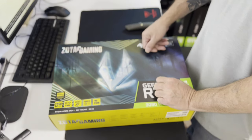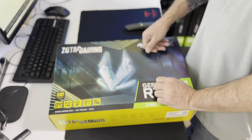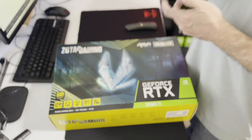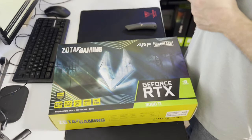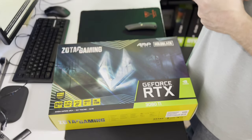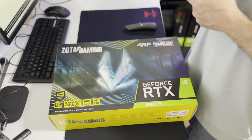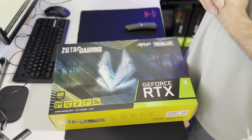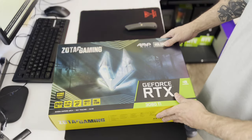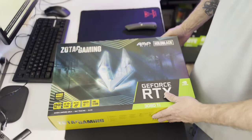And then I'm building another Cooler Master NR200. I really liked it so much I wanted to build another one to sell. It's going to be basically the same thing. I'm going to put a 58 in it. It's kind of a 58X, a happy medium. 16 gigs of 3600 RAM this time, a 1 terabyte M.2, probably use the Gigabyte board, and an SSD, probably a 0.5 terabyte. I do like that 8-layer Gigabyte Aorus Pro Mini ITX board. It's awesome. And we're probably going to be using the 850-watt Corsair SFX power supply. But that'll be for another time. Right now we're going to do this unboxing and take a look at the specs. I'm sure we've all seen them before, but it doesn't hurt maybe to go over them again.